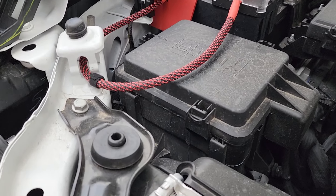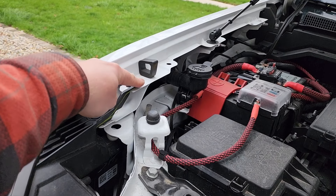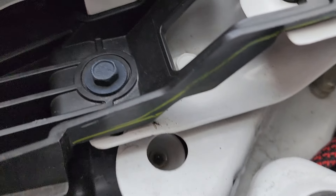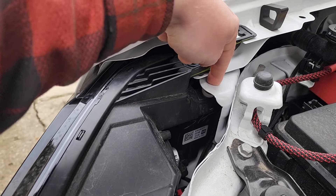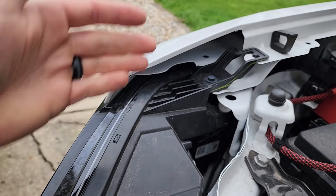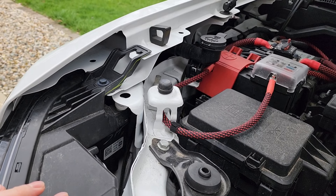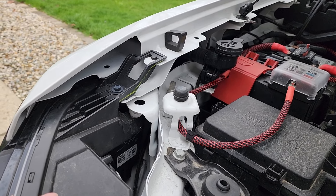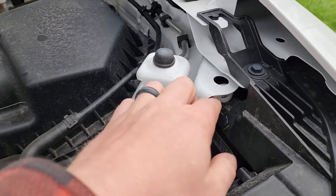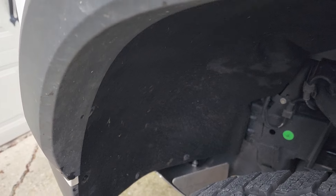I did want to show you how to adjust your headlights once you've made this change, especially if you have a lift on your truck. If you look in the corners, there's a bracket that comes up, and right below that is a hole. Below that, you can see this cup. Inside that cup there is an Allen. You just take an Allen fastener that fits it and turn it — you'll see the headlight move up and down. What I did was adjust mine, drove around, then pulled both my wife's SUV and mine at the end of the driveway, shot our headlights onto the garage door, and made sure they were roughly the same height. Then I drove around to make sure the lights weren't shining in anybody's eyes. Here's the one on the other side — that's how you access them. I'm going to remove the T15 fasteners on both sides and then we'll gain access and swap out the lights.